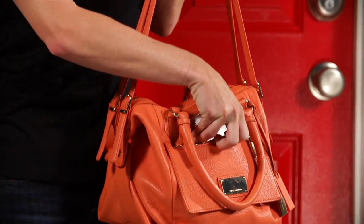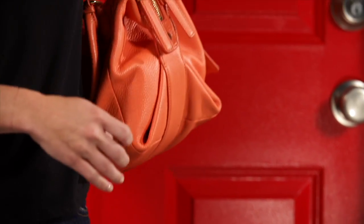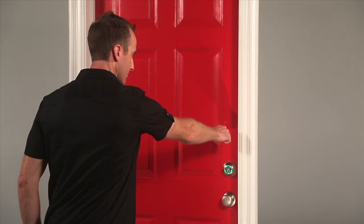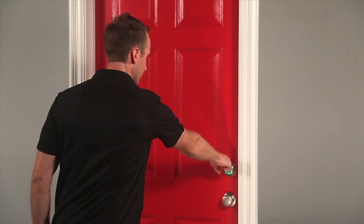Another thing to keep in mind, your device needs to have a direct line of sight to the lock. So, when it's in my pocket, I'll be lining it up with the lock. If you're calibrating in your backpack or purse, it's really best to have it in the outermost pocket that's closest to the lock. Also, we don't want to stand too close to the lock during calibration. It's best to stand at an extended arm's reach from the lock and give that signal some distance to travel.